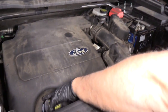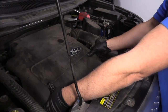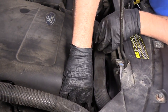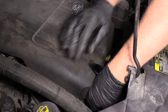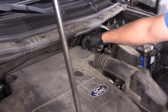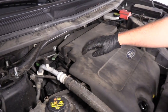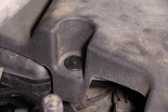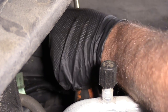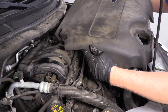I'm going to take the filler cap off right here, loosen it to the left. This foam piece comes up here. We're going to go around this cover right here and pull this up. There is a little retainer over here — I'm going to loosen this up and pull that up. Over here there's a little push pin, and you use a trim tool to pull this off. Pull that pin out and we'll pull this cover off and set it aside.